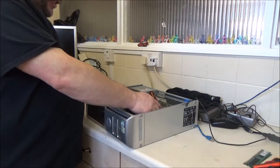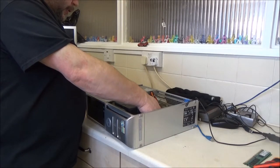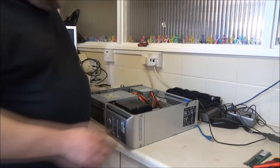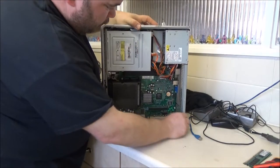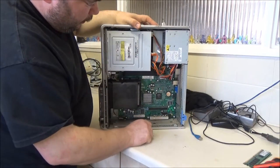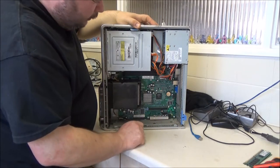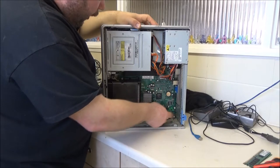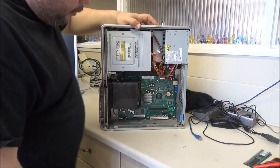The same with putting in upgrade cards - there's a PCI slot here as well. It's just got a little lever there, you can just pull that up, take out whichever blank you don't need, slot in your card, and push the clip back down. No screws required.